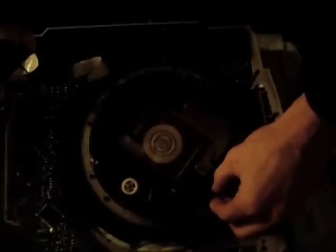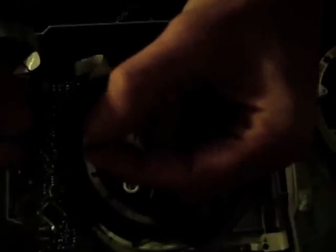Go ahead and remove these three screws — remember there are three springs under here so do not lose them. Remove this white circle. Take out all three springs and you're just going to stretch them out a little bit to make them slightly longer than they were, then put them right back. Do the same with the second and third spring. If you have an older set of CDJs you might want to go ahead and do this repair.